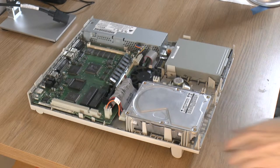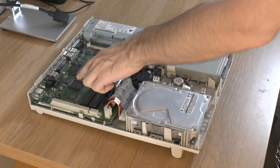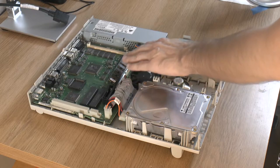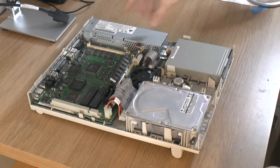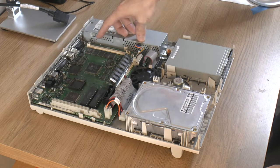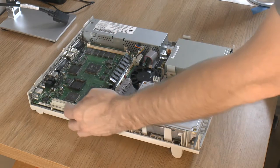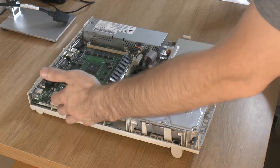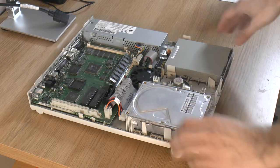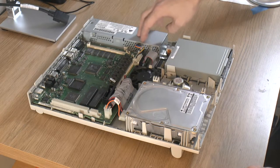Inside this system we have a 25 MHz Motorola 68030. We can have a floating point math coprocessor here. We've got four megabytes of onboard memory plus I think this is an eight megabyte stick. We have half a megabyte of VRAM and we can expand to another quarter, so 768 kilobytes of VRAM. This is an extension bus here where we could put a network card in. And then we've got the 50-pin SCSI drive, a floppy drive with some Apple standard connector, and the power supply over here.